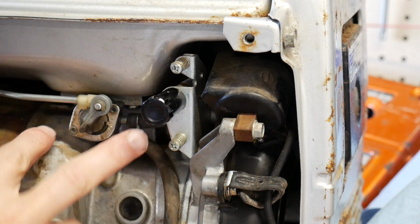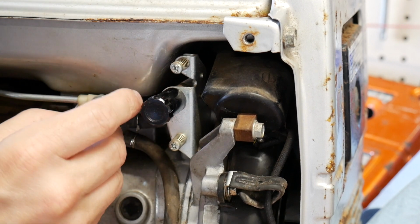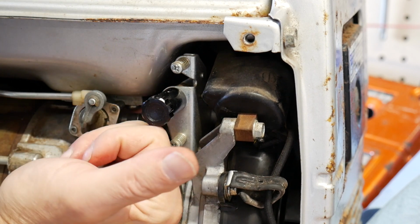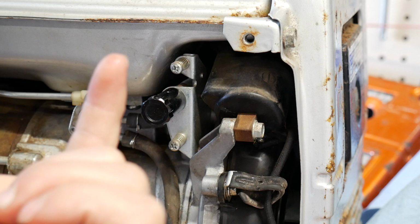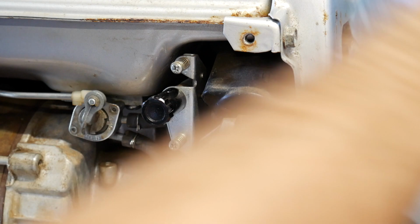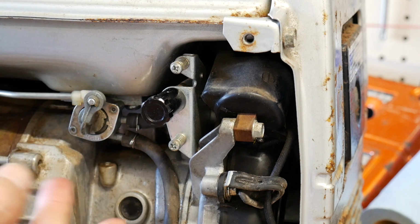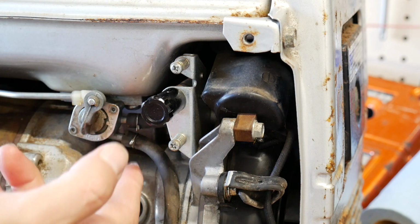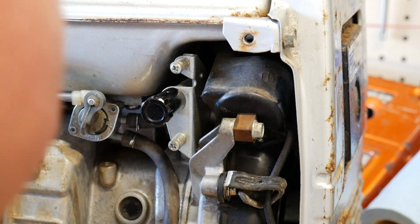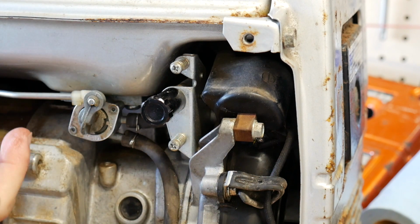There's two screws under here that hook to the bottom of the tank. There's a set of O-rings in there, and there's just a tiny bit of leaking going on. There's a little bit of fuel on the fiber washers on there. When I first got it, it was really dripping out of there. Put gas in it, it was just dripping out of one of them. Actually, I'd already had this tank off, truth be told. I flipped them over and put it back on there, and it cut it down almost to nothing, but it's still kind of just damp on both of them.